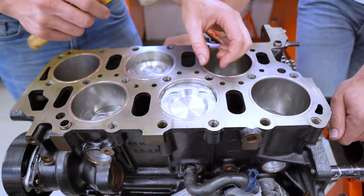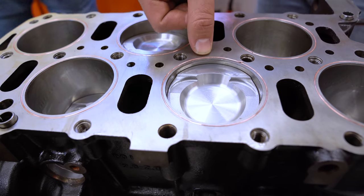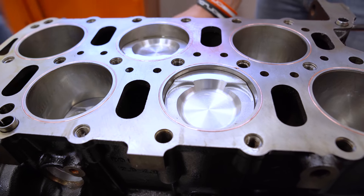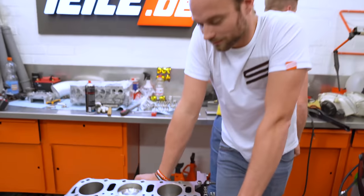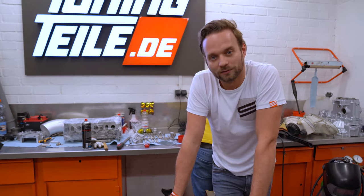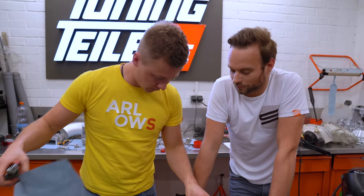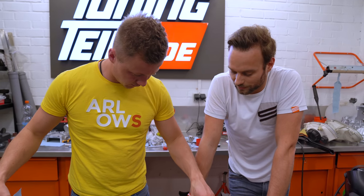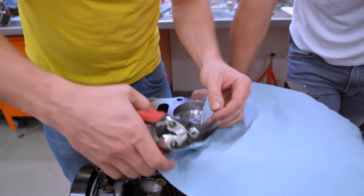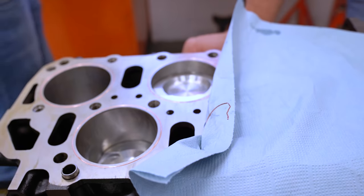That's why Marius with his steady fingers can now tap this ring in. For anyone seeing these rings for the first time: the idea is to create a slight raised area that later pre-stresses the head gasket at that spot even more, to improve the seal of the combustion chamber. A really cool principle. We've had it in my Limo for about 2 years now and it works perfectly. Björn was always against it - it's one of the few things where I stood my ground against Björn. And since then we've always done it this way.